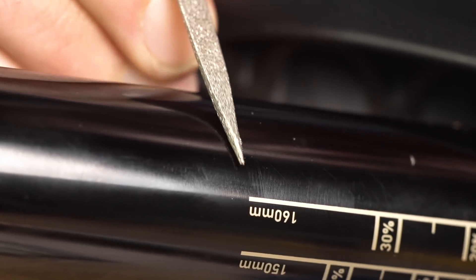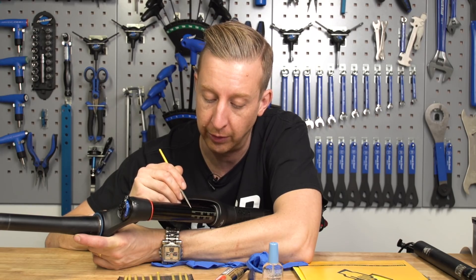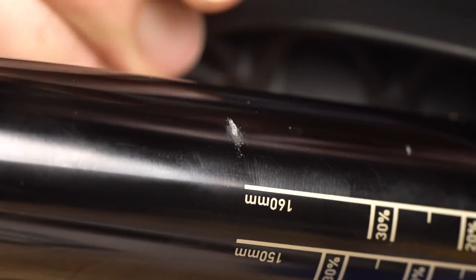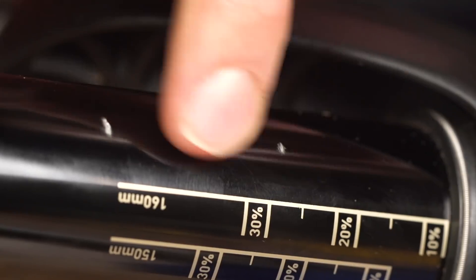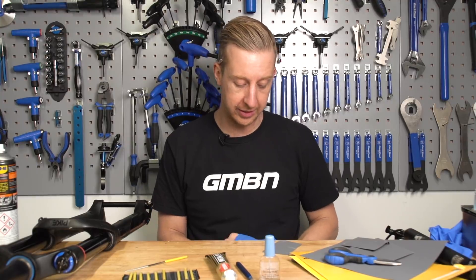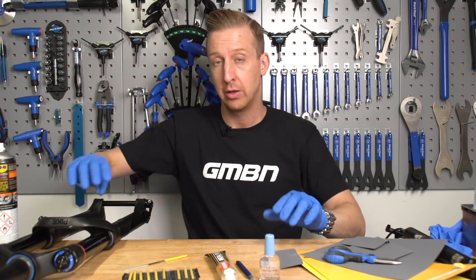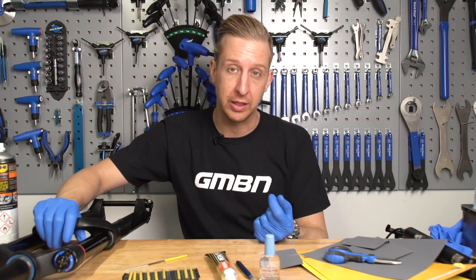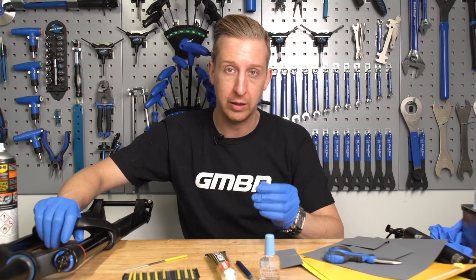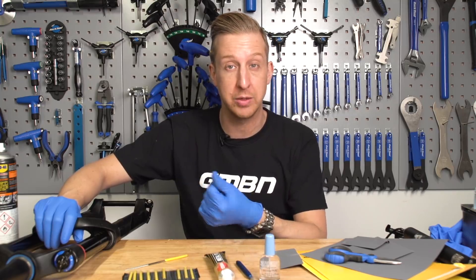It's a very fine job just to rub this down — take a little bit of care. Now you might notice I've taken the fork off the bike, which makes it a lot easier. You don't have to, but it's quite a precise job so you want to make sure you don't mess it up. Already it's starting to feel a little bit better. The aim is not to get it back to new condition — it's just to make it usable without damaging the fork further. So we're taking that burr off in step one, then smoothing over the scratch, and then filling it. Once it's filled, you level the filler, give it some polish with the metal polish, and it will feel like a normal stanchion passing past the seals.